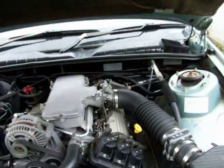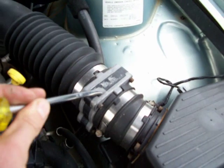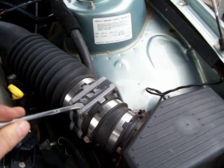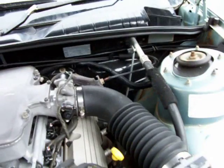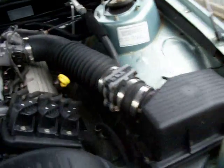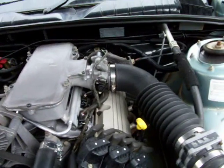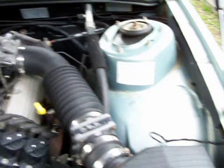If you've got a fuel-injected car and the idle is high and unstable, it means it's compensating for something. These cars have an air flow meter, which is there - though not all injected cars do. There are two ways of working out how much air is going into a motor. You can take the throttle position and the manifold absolute pressure - the sensor is actually down there - plus the engine speed and air temperature, and calculate the amount of air going in.